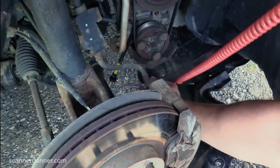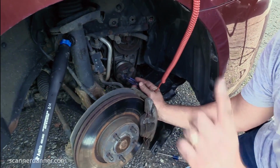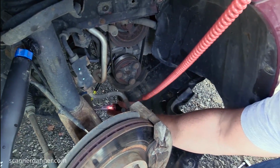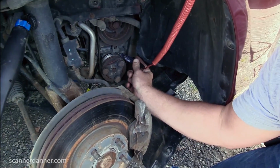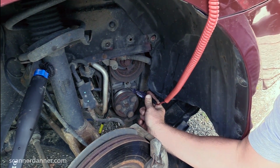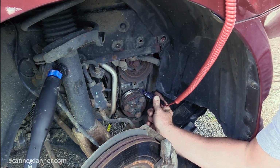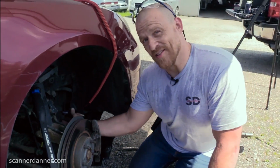All right. Okay. How do you test a clutch ground? First you load the circuit. Is the circuit loaded right now? Is my test light lighting on my tool? Yes. Circuit's loaded. All you need to do, touch the housing. If the ground was bad, my test light would light. It would be lit on the ground of the housing. It would light. How? Because it's open, and if there is no ground, there's no voltage drop, and so it would actually light on the housing.